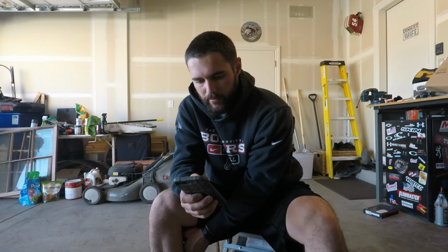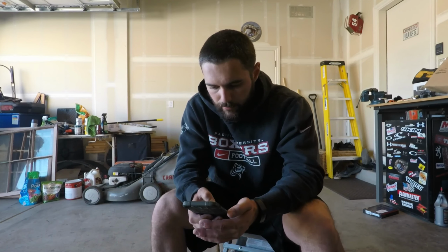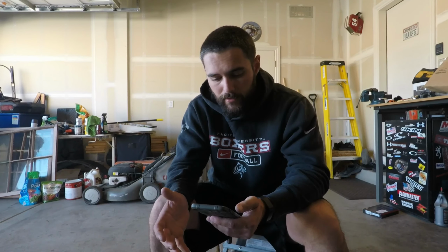Eddie McGuire: Do you recommend a naturally aspirated 6.0 build versus boosted? Would you ever move to boost? Well, if you want to boost it, I'm all for it. I love turbos. I think turbos are awesome, and especially in higher elevations. The power loss with elevation is less with the turbo. The turbo can just spin a little more with elevation. Gale Banks did a thing on it. The higher in elevation you are, the more horsepower you lose. A turbo can make up for a lot of that, not all of it.